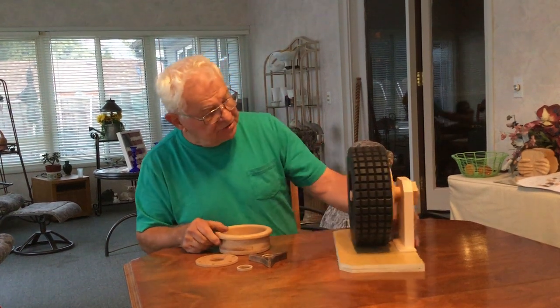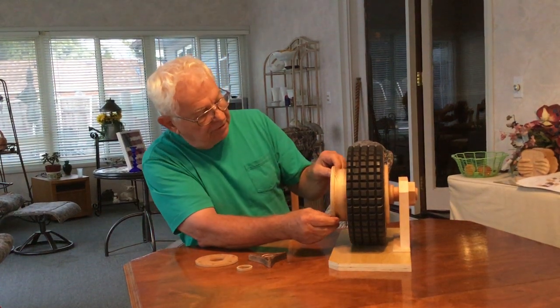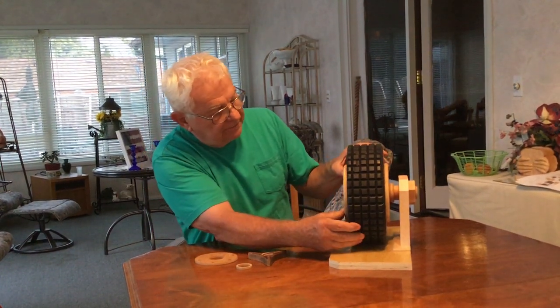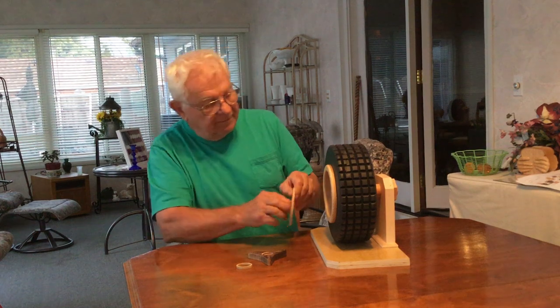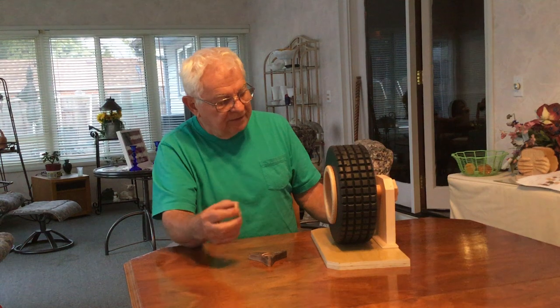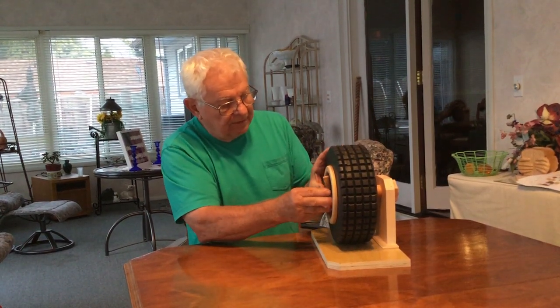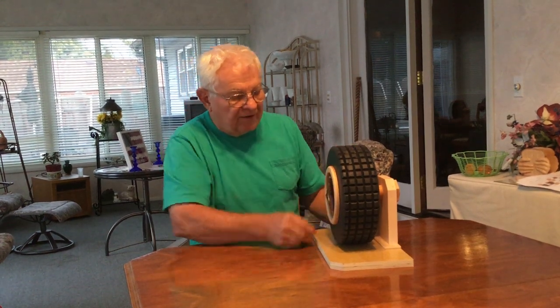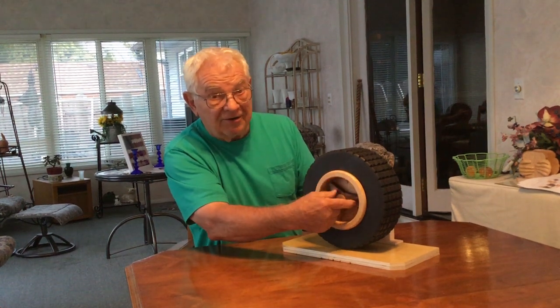Here's the other half of my six-pin wheel, so that goes in there. When you got that done you got to have a pressure plate so that when you put your knockoff on it holds everything together. Here's our outside spacer and we'll put our knockoff on. This is for you Milo — it's left-handed threads on the right rear or the right front on a race car, so I done left-handed threads.